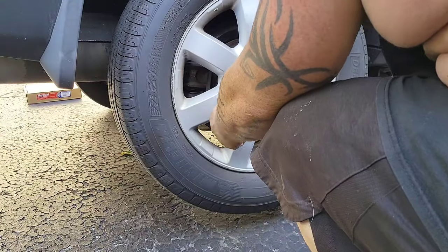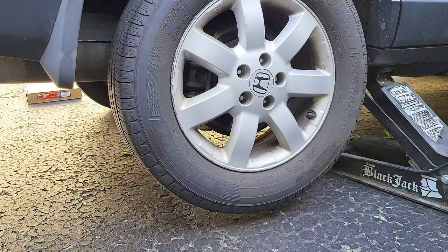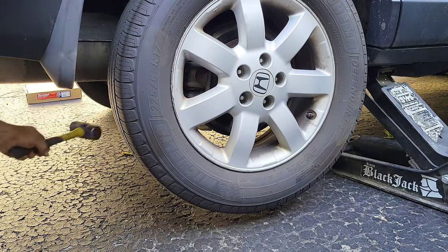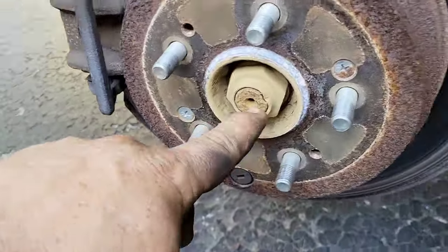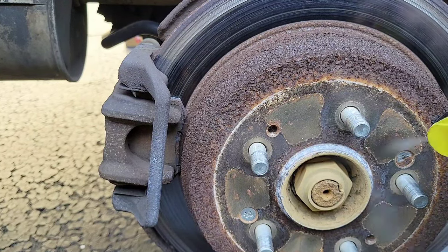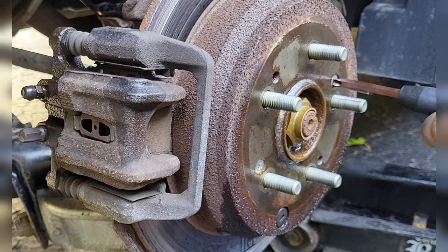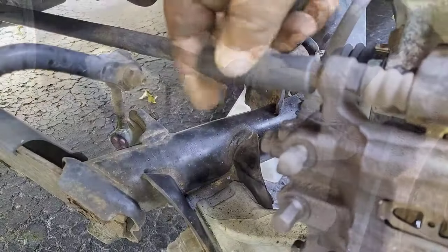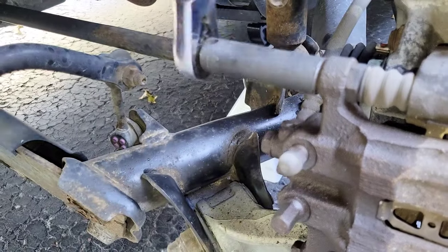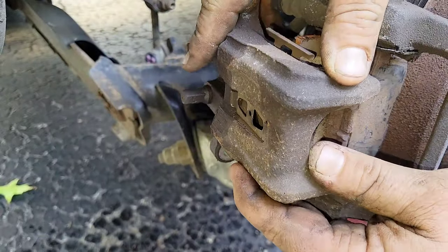I'm going to run into Napa real quick. It says the rotors are in stock, so we'll see — half the time that doesn't mean much, but it says there's four of them. We got it jacked up here. Those ones are on there good — we need our hammer for this one. Go from the inside. I love having screws in here. Before we do anything, let's hit this with a little PB Blaster right there. These rotor screws — you can use a hand impact like this, or just drill them out if they get stuck. I got that one out, but I'm failing with this one, so I'll go ahead and take everything else off.